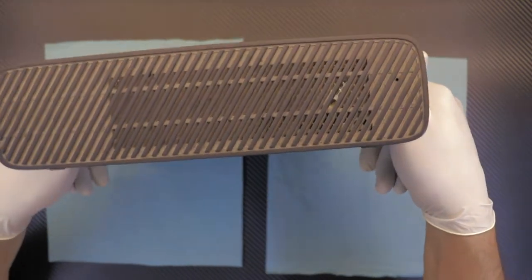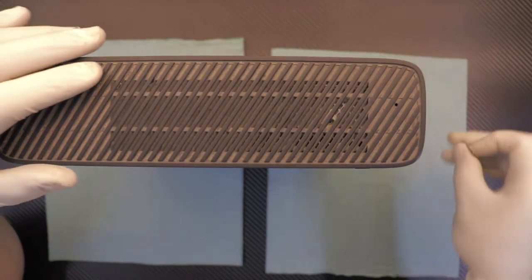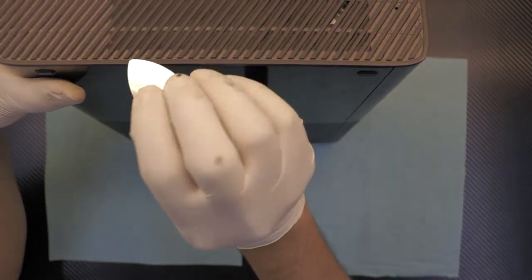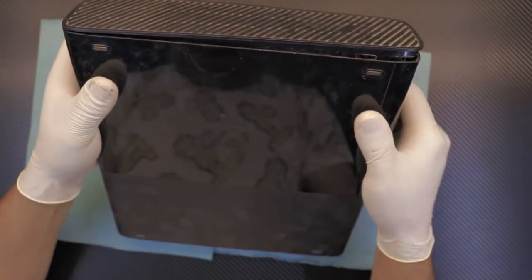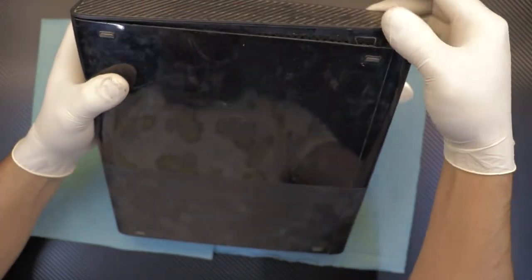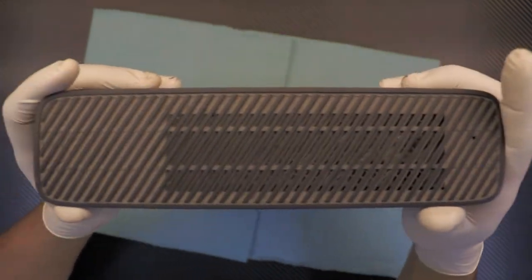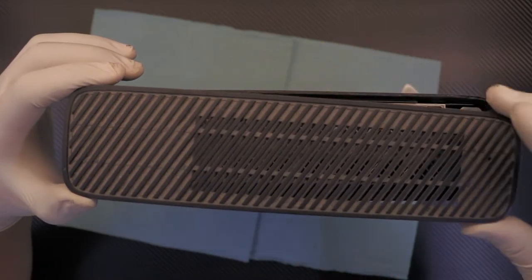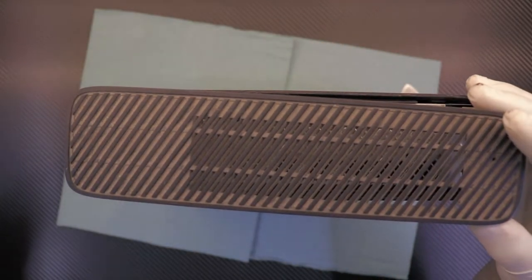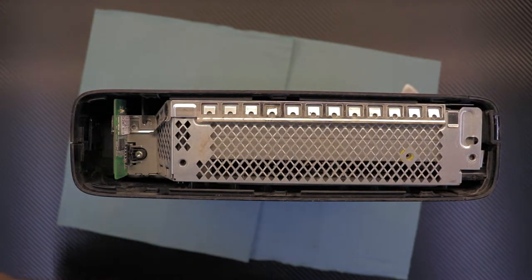On this side we're done, so flip it to the other side. On this side there's no hard drive or any other cover except this main cover, so do the same thing — put it on the side. Once you've got the front side up a little bit, jiggle it around and it will come out. It is really dirty; you want to clean it with a toothbrush — an old toothbrush is cheaper and you're kind of recycling.